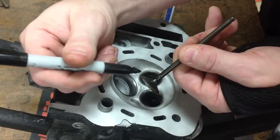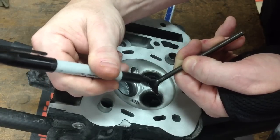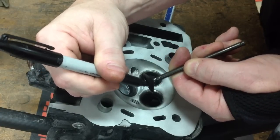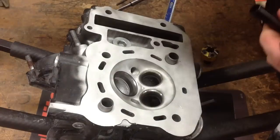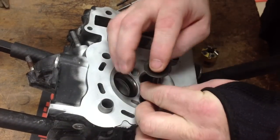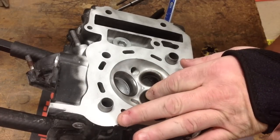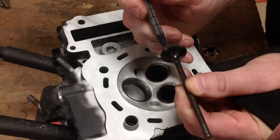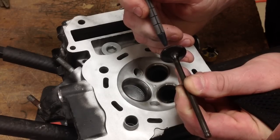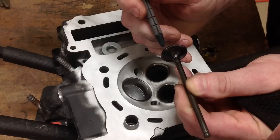Before we make the cut to narrow the seat, we're going to find out where the seat is hitting the valve face. This is a pretty simple step — nothing high-tech involved, just a little permanent marker. Ross is going to mark the entire face of that valve, then slide it down into the head and rotate it a little bit. That'll wear the ink off of the area of the seat that's coming into contact with the valve face. If you notice, the ink is worn off only from about the middle third clear off the end of the valve — off the margin. So we know we want to take material off the top of the seat to move that contact area down onto the valve face.